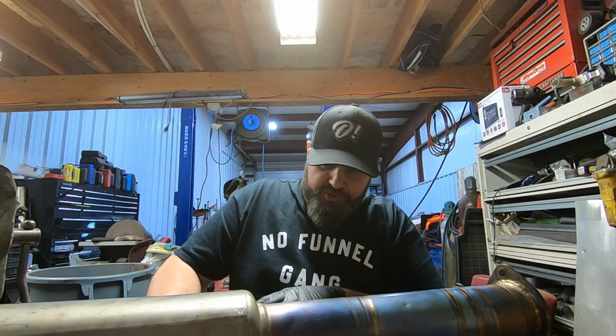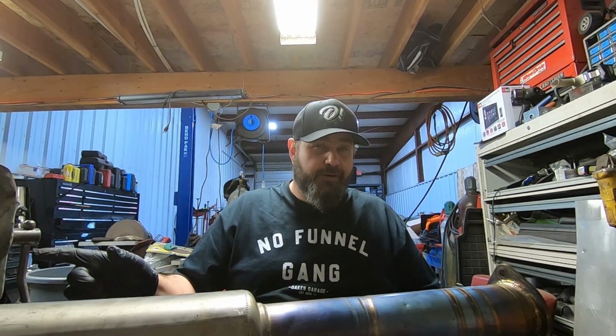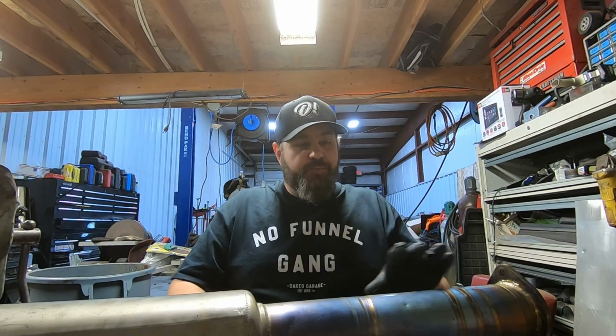Alrighty, so now that we got that section straightened out, we got our pipe straightened out back here, we're going to go ahead and clean this up and throw a weld on it. Now I have the back purge gas going, I'm sure you can hear it. And we're going to just take a Scotch-Brite on this real quick.